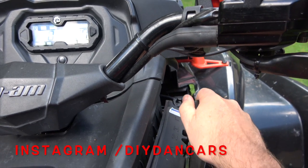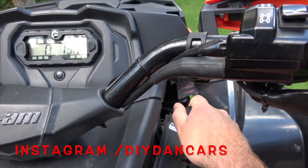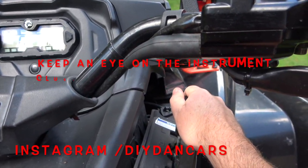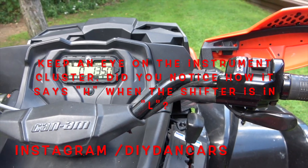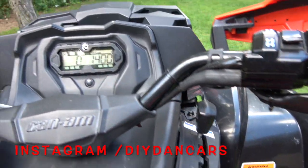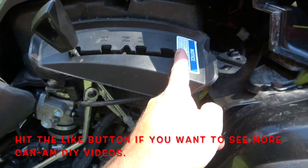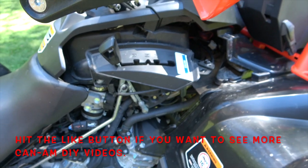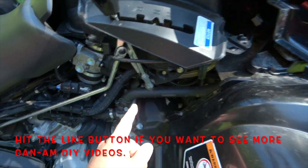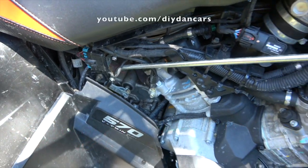Unfortunately, I did have a few problems with mine. The first problem I had was with it staying in low gear. My 570 XMR would either keep popping out of low gear or not engaging at all. When it did pop out of low gear, it made a horrific grinding sound. I later found out the shift linkage wasn't adjusted correctly at the factory. I didn't want to hassle with bringing it into the dealer, so I fixed this problem myself. Click my playlist link in the description — I created a DIY video to help others who may have this same problem.